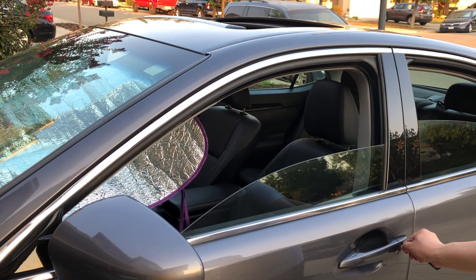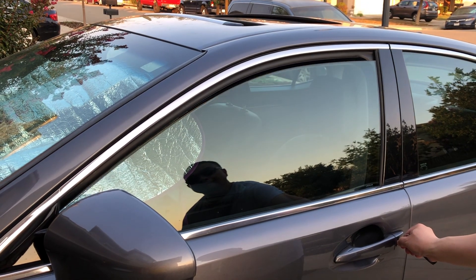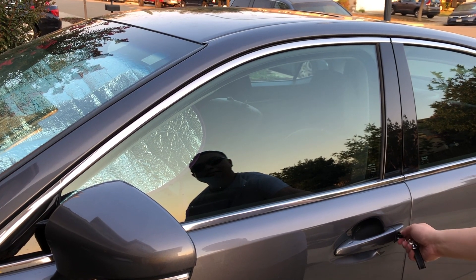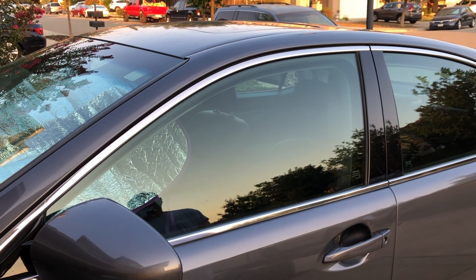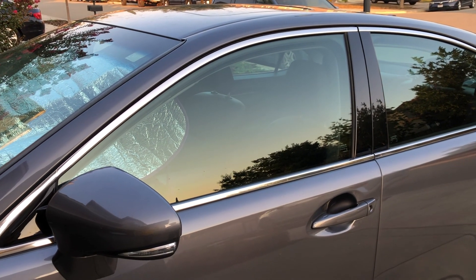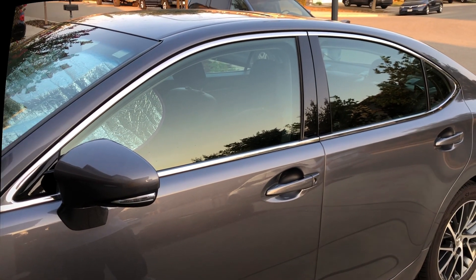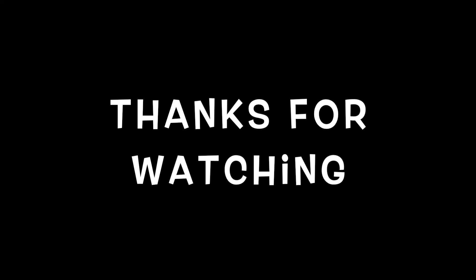To close everything, take your remote, press the button, and take the key out. Insert the key in the driver's door, turn it to the left, and hold — everything will close back up. Simple as that. This trick definitely requires the programming we did for it to work. The opening feature is really useful if your car is very hot in the summer. Hope you like this video — I appreciate a thumbs up, it helps a lot. If you have a comment or suggestion about trying this on different vehicles, please post it below. See you next time, bye!